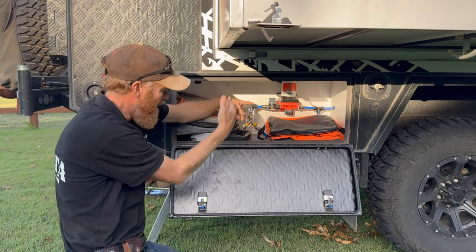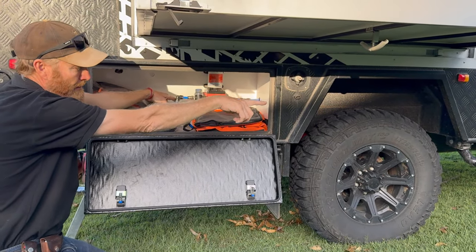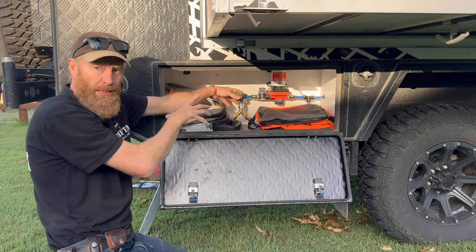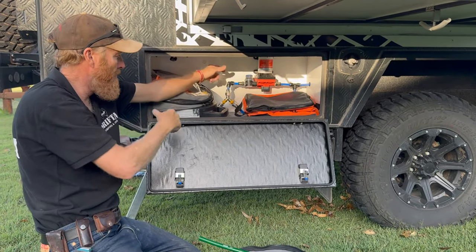What that's doing, the rear tank is here, the second tank is there, you can see them underneath, and the grey water tank is at the front, in front of the axle. So you've got one tank here, one tank here. A sensible thing to do would be use the rear tank first, and you're getting rid of the weight from the back. So you've got to use some water first, you may as well use the rear. So that's what I've done.